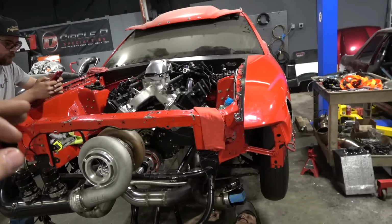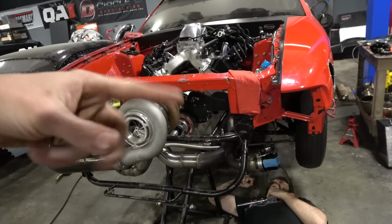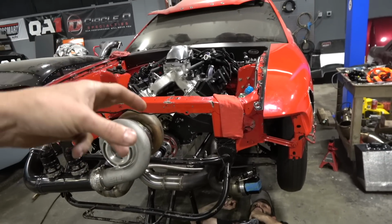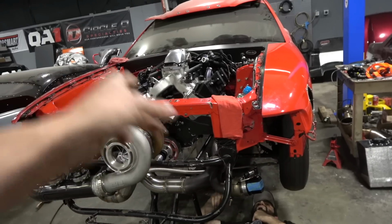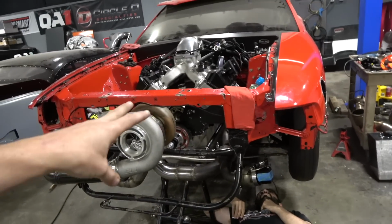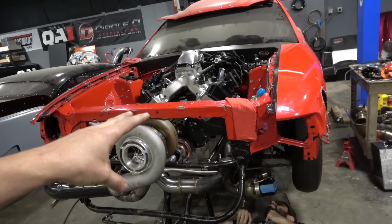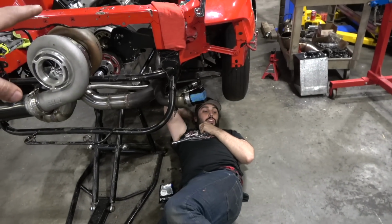That's what the oil filter adapter housing is. Normally you have a stub coming out for your oil filter screw-on, so you just take that out and then you put an ORB fitting in there, and that's for if you're going to be using an external feed going into the block. Well, everything else, all our other small block Fords, I knew that it was a -12 ORB, this one is not. So it's some China. Well, I don't know. It's definitely not, because this doesn't fit when you thread it.